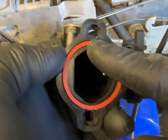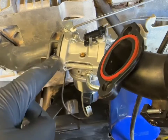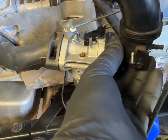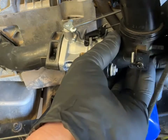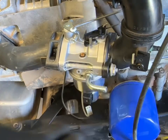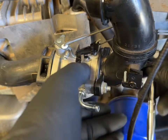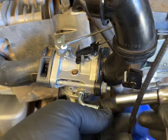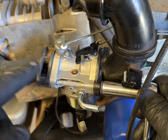Now let's install the cold air intake. Double-check that the gasket here is intact — you do not need any RTV or sealant, they just dry-fit. Go ahead and stick it on and install your nuts. Use an 11 millimeter and bring up equal pressure on each side. Don't over-tighten because you can crack the plastic, same as the intake.